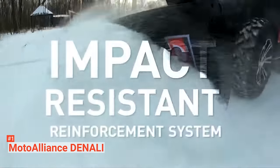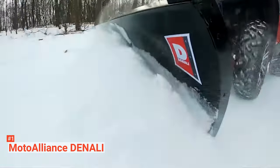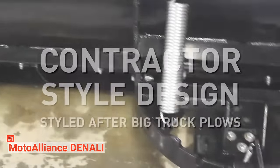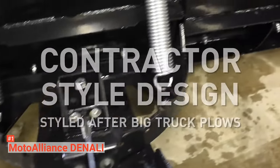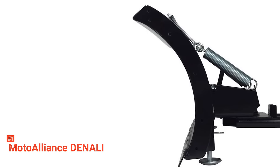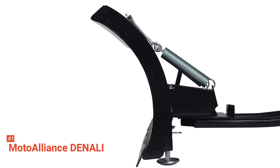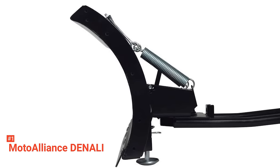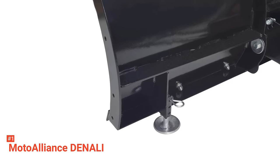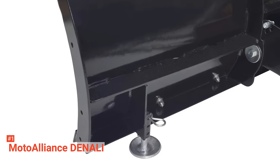Aside from the blade, Denali comes with 2 replaceable wear bars and push tubes for maximum strength and easy installation. It also has a plow mount, adjustable steel skid feet, an installation manual, and a 3-year warranty. The easy connect design makes attaching and detaching the snow plow an easy process. A winch is not included in its kit, but is required to raise and lower the plow blade, so you may need to buy it separately. Viper Elite, Max, or Midnight Series winch are recommended.